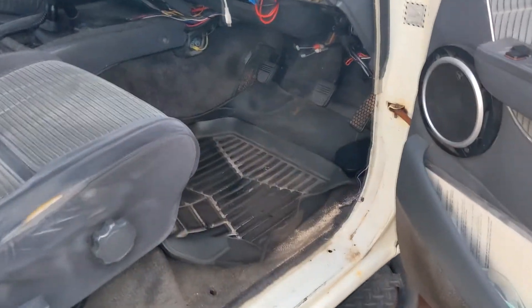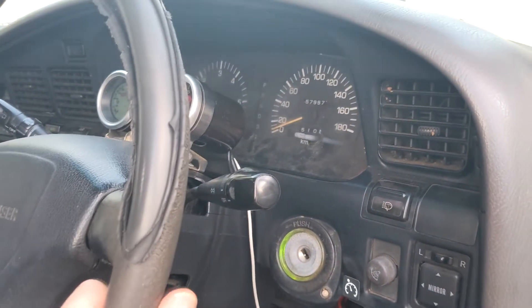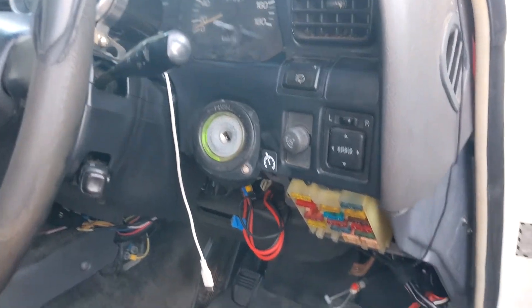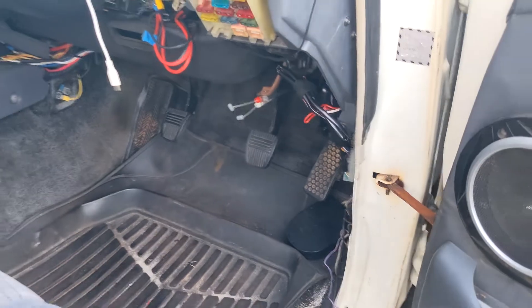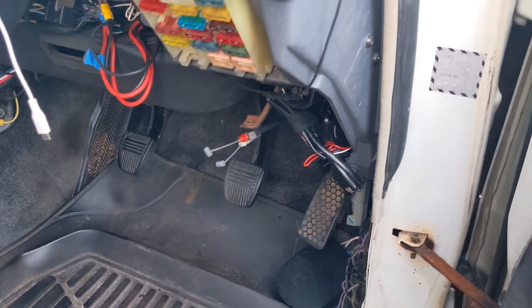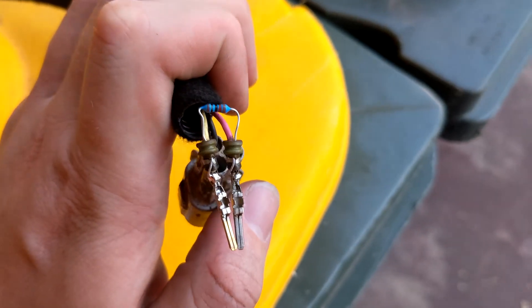It works! The 10k pull-up resistor circuit worked a treat — it's all working fantastic now. I took it for a test drive and it is so much nicer: the delivery is beautiful, it stays to the set speed, doesn't hesitate, doesn't go up and down. It was very jerky before, which I was annoyed about because I'd just spent $700 on this cruise control trying to fix the problem. In hindsight I probably could have just put a new speed sensor in with the old setup, but I'm glad it's fully electronic now with the correct clutch switch. Here's the completed version — the resistor is poking through the seal, soldered on, back in the connector. A little bit rough but it works.